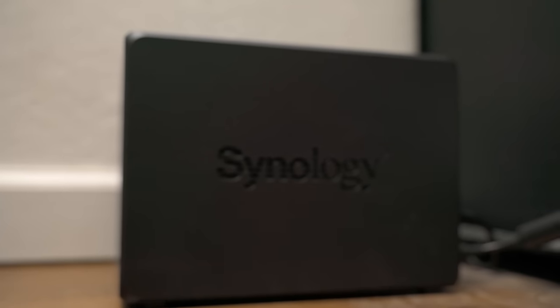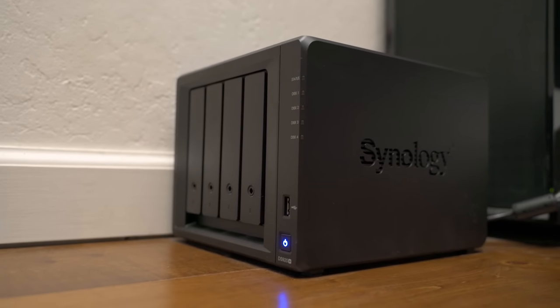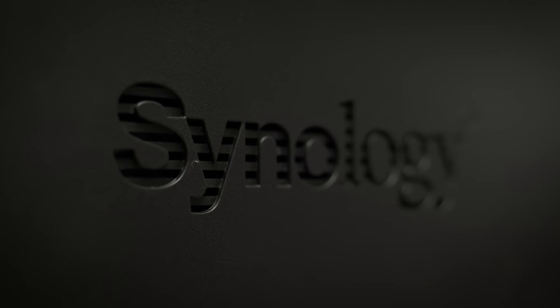Next is my most recent upgrade — my Synology NAS, or network-attached storage. I made it a couple of years with just four terabytes of internal storage, but I'm filming more often now and more often in 4K, so I knew it was just a matter of time before I needed more space. I picked up the Synology DS920 Plus, which has four bays and you can connect it to a network or directly to a computer. I have four 4TB drives set up in RAID 5, which gives me close to about 11 terabytes of usable space. If you get the right drives and set them up differently, you can easily get 40 or 50 terabytes of extra space.